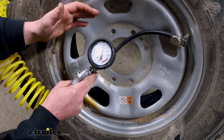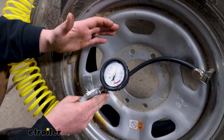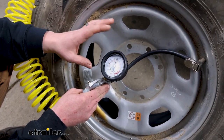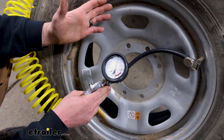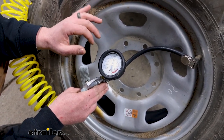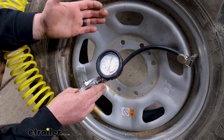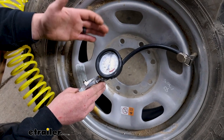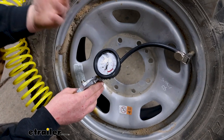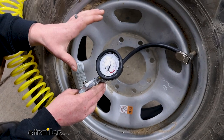It seems to be doing okay, and this is a good example of how it can get you out of a pinch. We were able to get it to 80 PSI. From about 20 to 50 PSI it did that on the first swing — ripped through it like it was nothing. After that 50 PSI mark, you'd get five to seven PSI, wait a minute for the compressor, get another five pounds, wait a few minutes. It really started to slow down in that higher range, which is expected at 80 PSI in a tire this large — this one is a 275/70/18, a big truck tire. We were able to get 80 pounds of air in it, and it would go more if we wanted. Pretty impressive for a little onboard air compressor kit.